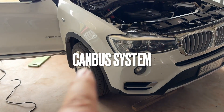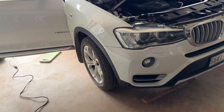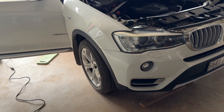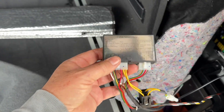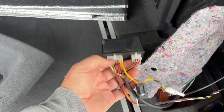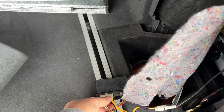Modern cars check all the globes and wiring through voltage to detect blown bulbs, and can tell you which globe has gone out — very clever. But if you start putting extra electrical loads on there, it's going to get confused and throw codes on the dash. So when you've got a seven-pin plug added to a car like this, there will always be a module like this one to deal with that. When the brake goes on, this module — which is also connected to power and earth — sends the signal out, preventing fault codes from all the trailer lights pulling current.